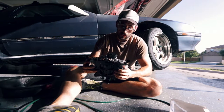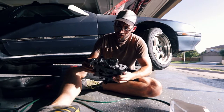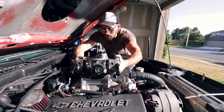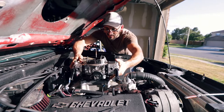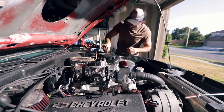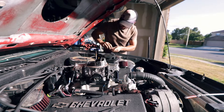I also need to adjust these springs here - in between the pump and that piece there needs to be about 15 thousandths. If it's not right it could be putting too much pressure on the pump, and that may be what wore it out. But outside of that it should be pretty good. That's the thing I love about these carburetors - they are so simple, it makes replacing stuff super easy.